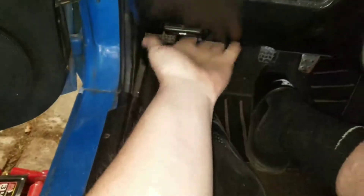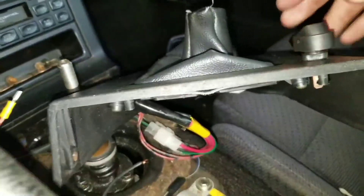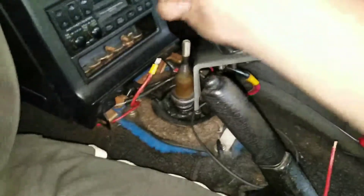Coming into here, what I did was I took this wire and routed it under the steering column and in through the center console under here, and then attached this. When my switch — which will go here — the center console will sit this way so the shifter will be here, and the switch will be about here and that'll just plug into the switch.